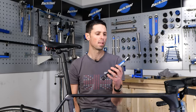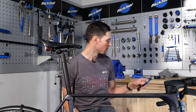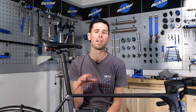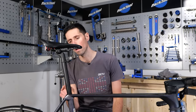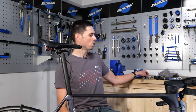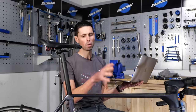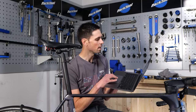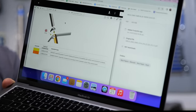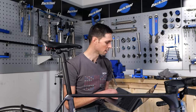There are two different torque wrench examples here from Park Tools — this one is the TW-5.2 ratcheting torque wrench, and there's also a smaller, easier one to use. All different bikes will have different torque settings for how tight the seat clamp needs to be; usually it is written or painted on the component or frame, somewhere in the region of five newton meters. On this bike it actually isn't marked, so I've gone online and found the user manual. It tells me the torque is five newton meters and also highlights where to apply grease and fiber grip paste.